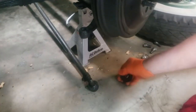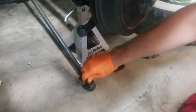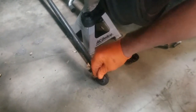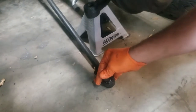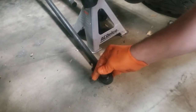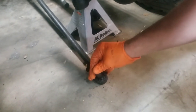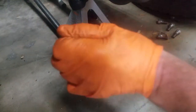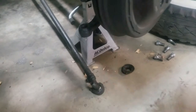This one has a rubber cap — take the rubber cap off. We're going to wiggle this back and forth. You see it's supposed to rotate a little bit, but it actually makes a little clicky noise. It's not rotating, but it's still moving, and it's not supposed to do that. It should just rotate — it shouldn't tip back and forth. When we had the wheel on, this tiny movement down here was causing a large movement in our tire. That tells us our tie rod end is bad.